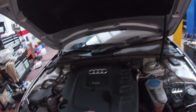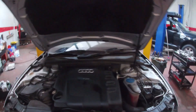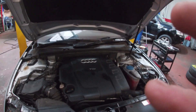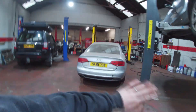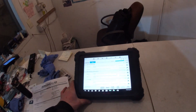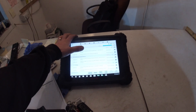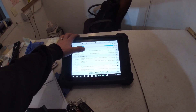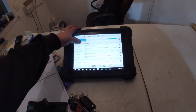The DRV valve is done. Timing belt and water pump done as well. Hopefully it's all good. The brakes are working but they're terrible, so I'll need to bleed them again. Before I had absolutely nothing — even with a new master cylinder on it, we had absolutely nothing. We've got some diagnostic faults: electronic supply for parking, supply for left LED parking lamp, daytime running light, supply for right side — these are just because things have been unplugged. Airbag crash sensor showing open/short circuit — hopefully it's just because it's all been unplugged, so it will clear. The aircon won't clear — there's no gas in it.